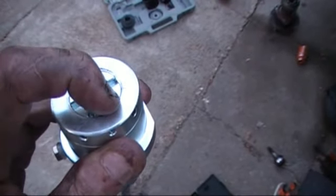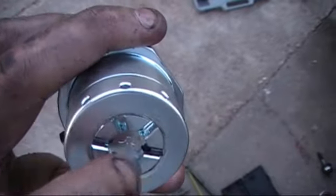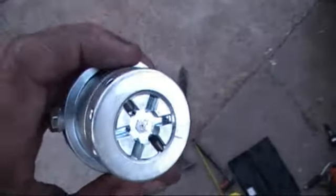Now, if your knuckles have gotten bent or your C's have gotten bent, you're probably going to have to take some clearance off the Pro Steers a little bit — let me show you where. Back here you have the adjustment splines, and you have this little pocket here. These little notches go much deeper in. What you're going to have to do is dish this out just a little bit — see these little sharp edges? You're going to want to smooth this out. The easiest way: take a four-and-a-half inch grinder, have somebody else hold the part, and gently concave this area right here. You can either do it with the ball joints assembled if you don't get it too hot, or you can knock these roll pins out and do it that way.